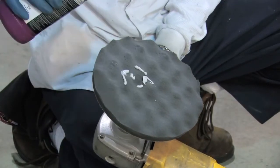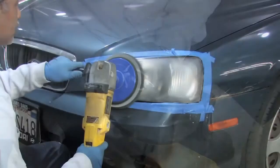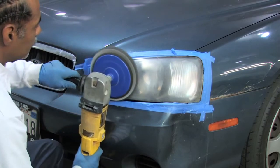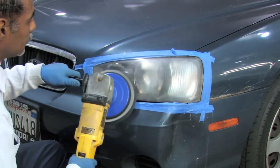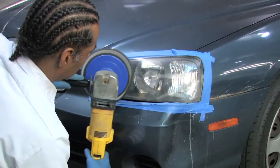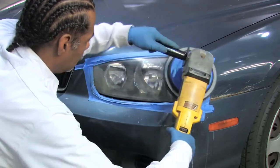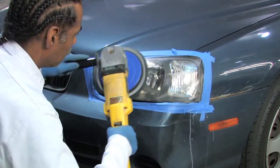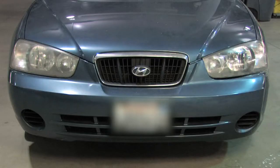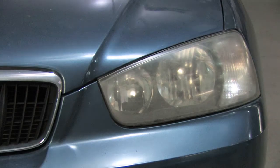The next step is to use some glazing polish and a drill at low speed with a pad to get as much of the damage off the lens. Then we're going to polish the lens — you're going to be really surprised at the polishing stage how clear your lens already looks. Polish evenly across, and you might need to do it a couple of times. There you have it — that lens compared to the old lens looks almost new.